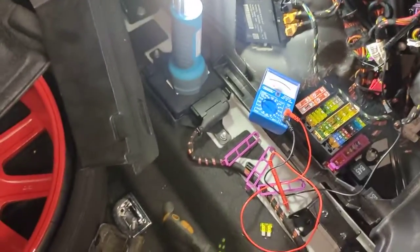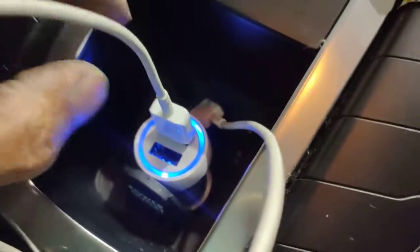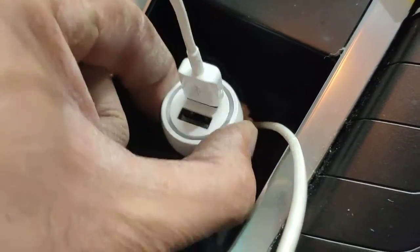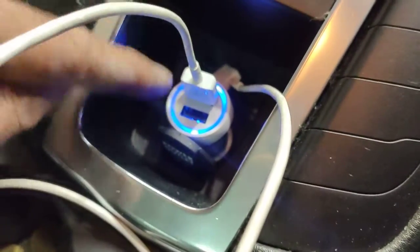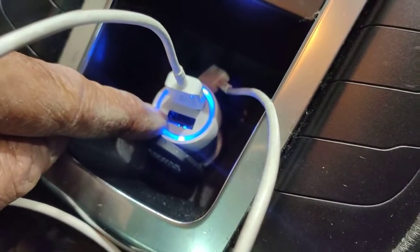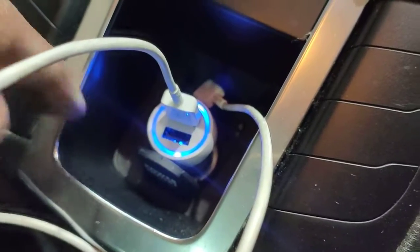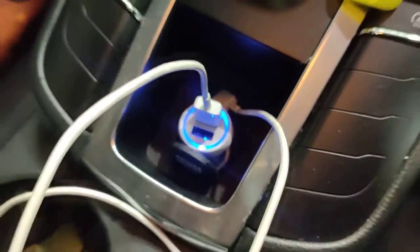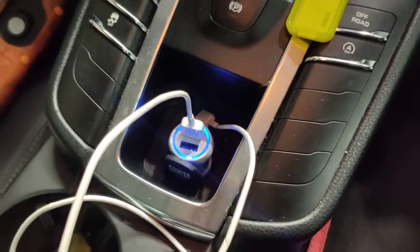All I've got to do now is put everything back together and check the front. As you can see I can take my light — that's on already, so that means it's working. Off, on — that's sorted. So if you have a Porsche Macan with the cigarette lighter not working, just check your fuse at the back, right hand side rear on a right hand drive car, and change the fuse. I'll get a new fuse today and put everything back together. Thanks for watching and please subscribe.